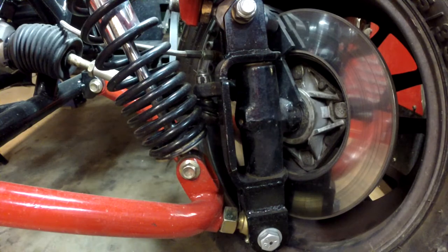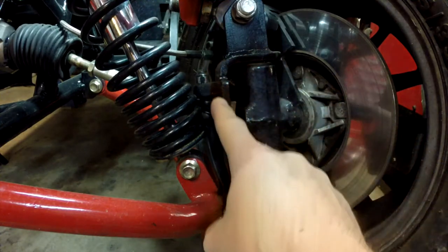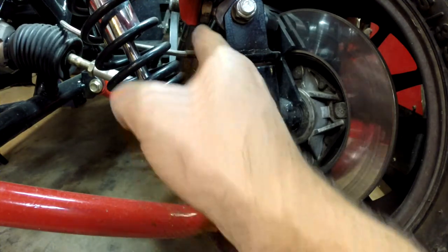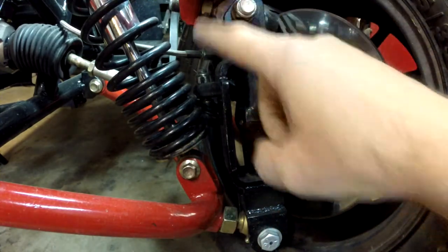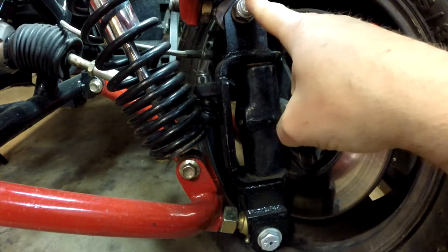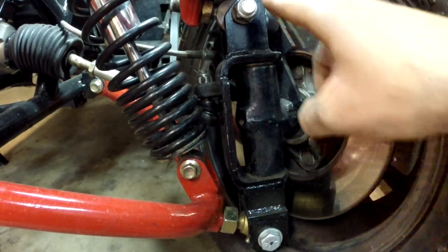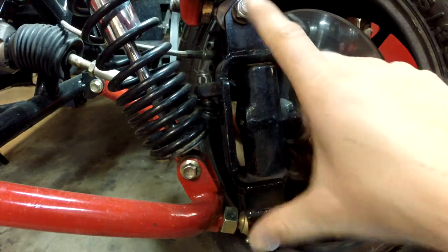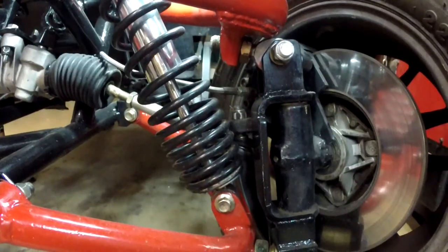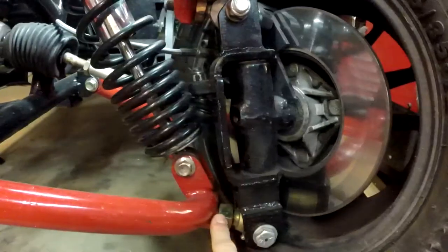Here's a shot of my spindle assembly. This piece and this C-piece are both EasyGo parts — the original front suspension beam was mounted right here, and I just cut that off. I've added a tab on top to mount my heim joint and a tab down here for my poly joint. I made that span as far apart as possible without interfering with the wheel, which gives a little more stability. The heim joint gives camber adjustability, and so does the bottom poly joint.